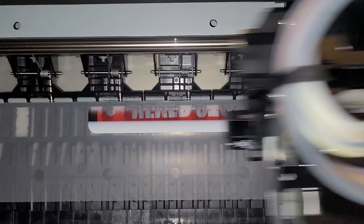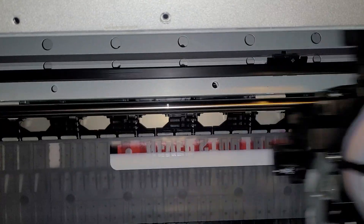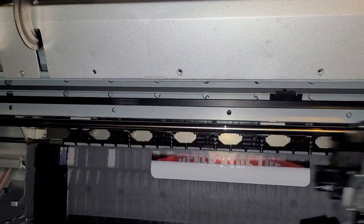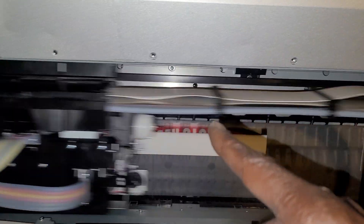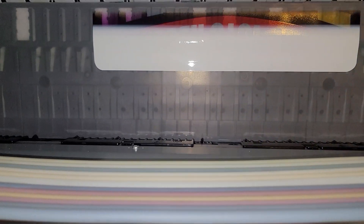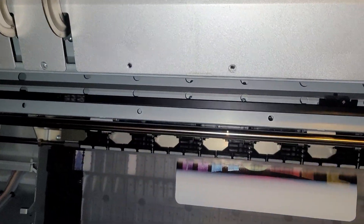I can hear a little clapping sound from the printer — something at the top isn't fully connected. I had to change my ribbon cable; sometimes these ribbon cables go out and you have to replace them. That's the cable you see on top going up toward the ink selector. I'll probably just snap a small plastic piece back on once printing starts. You can see the white coming out — that's my FOMDTF white. This is my full ink setup: C-Y-M-K plus whites. No camera tricks here.